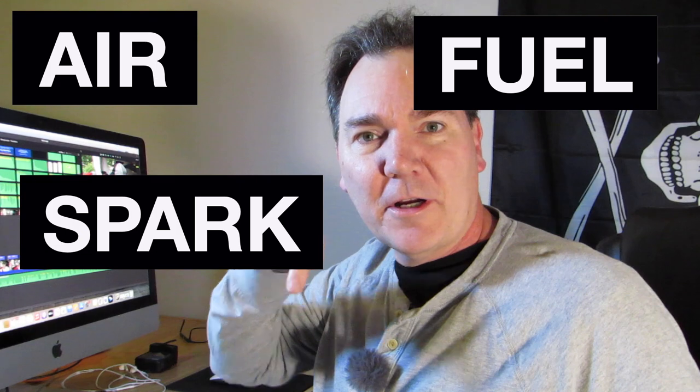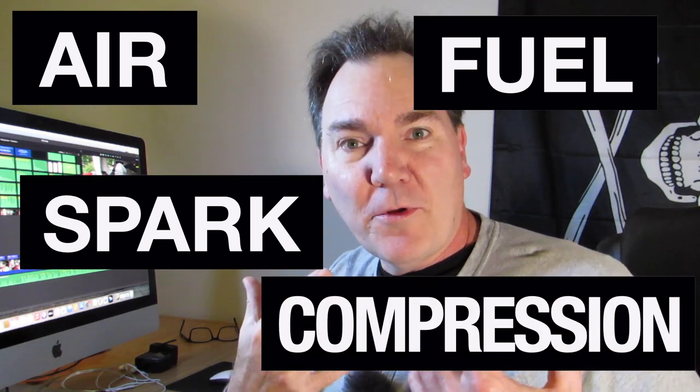I'm going to pause here and talk a little bit about what these engines require. An engine requires four basic things: fuel, air, spark, and compression. It requires those four things in order for it to work. In this situation, I knew I had fuel in my tank, and I know I had spark because it was running. Obviously it's getting air and compression because, once again, it was running. But if anything breaks down in any of those four areas, that's what can cause your engine not to run.